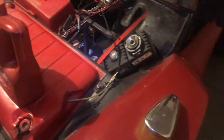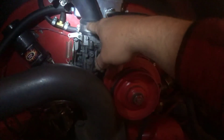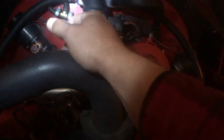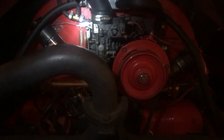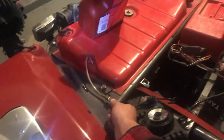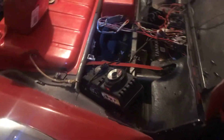This right here is a fuel return line to the gas tank — like fuel-injected cars have today. Back here is the return, so instead of the fuel sitting there getting hot and starting to boil and vapor lock, it just returns to the tank so you always have nice cool fuel and won't vapor lock in heavy traffic. You can run it wide open or shut it — doesn't matter either way, but I recommend leaving it wide open.